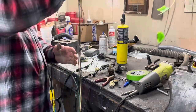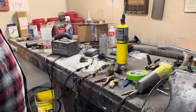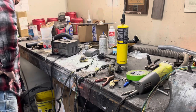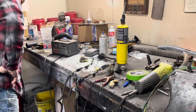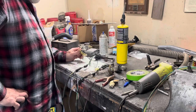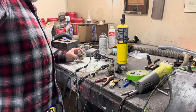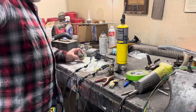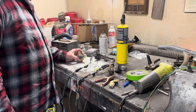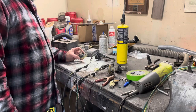All right, so we got that figured out. So I think on my tail lights, I'll have to come off and do a license plate light off of that too. So these sockets will not work in those lights, I don't think. I can see if I can make them work in there. Probably what I'm going to do is cut the original sockets off of the old wiring harness. They look like they're in pretty good shape, and use those. So I'll see if these will fit in that.